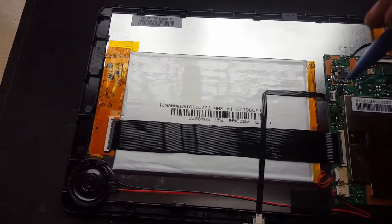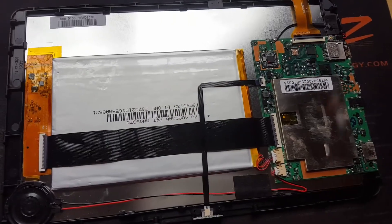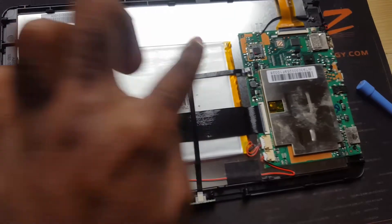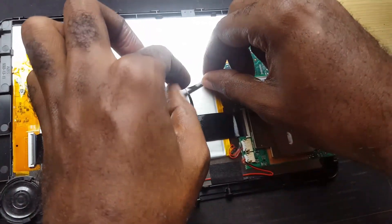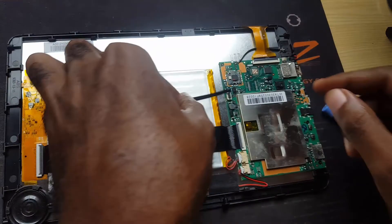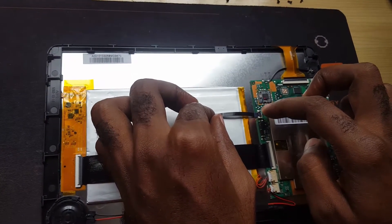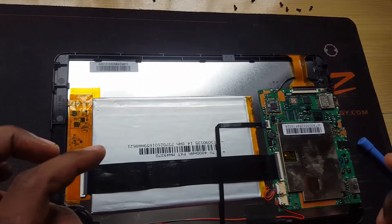Let me show you how to disconnect the ports. Using this tool, I'll flip up the ribbon cable connector — just pinching up, and there you go. Very easy. You can change out this section just like that. In case of corrosion causing charging issues, double-check this connector and rub off any corrosion, then place it back in. Slide this section back in carefully — it should go right in — and then clamp it down. Quite easy, and it's in.